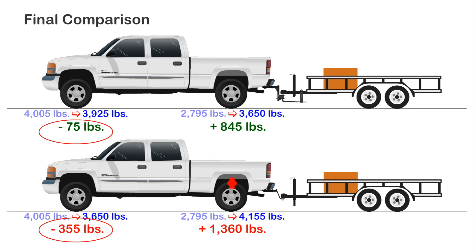With airbags inflated, the trailer axle weight increased by 125 pounds. With the weight distribution hitch, it increased by 365 pounds. The weight distribution hitch is better at relieving some of the tongue weight burden from the tow vehicle's rear axle and placing it on the trailer's axles. Thanks to Jason for taking the time to set up his equipment and share his expertise to help us see the difference between fixing sag with an airbag system versus a weight distribution hitch. If you like our videos, please subscribe to the channel and follow us on Facebook and our other social media pages to join the conversation and get entered in prize giveaways and contests. Thanks for watching.